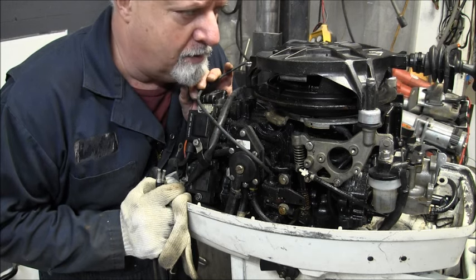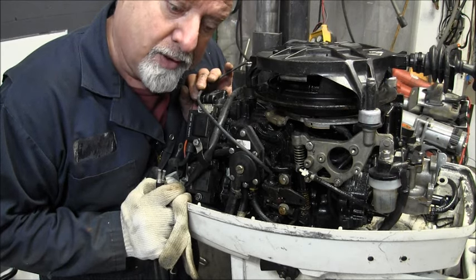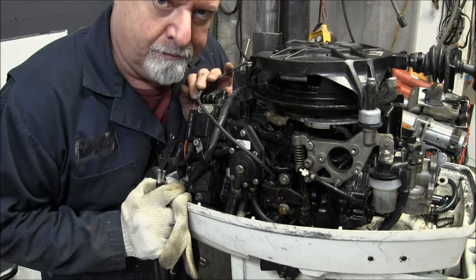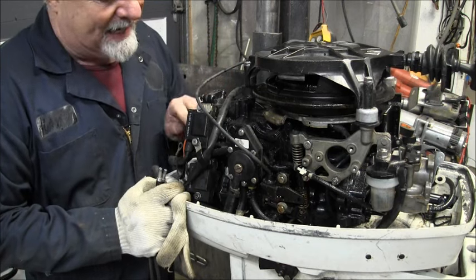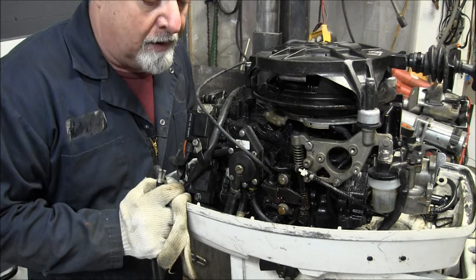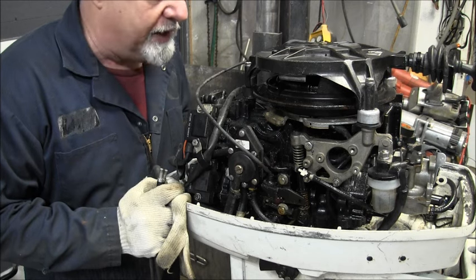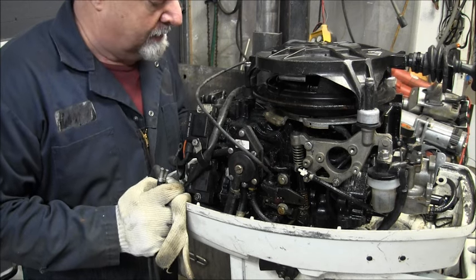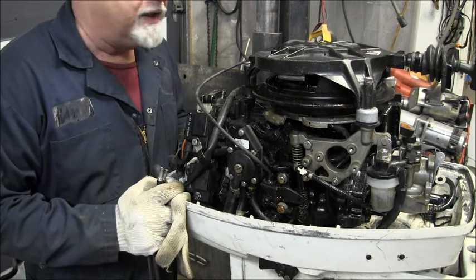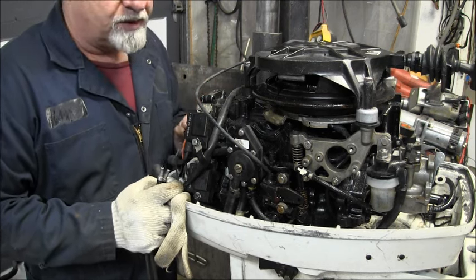is just look around. Sniff around. See what you see. See what you smell. You're going to inspect it. So if I see melted wires or torn, super corroded, the first thing you're going to do on a check is give the engine a good once over. Look. Peel these wires, move them, look for really corroded stuff. This is a saltwater engine. I did find a corroded ground on here, but it was the pack.